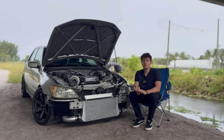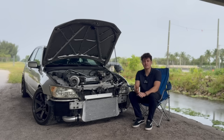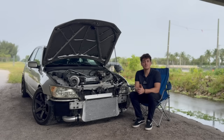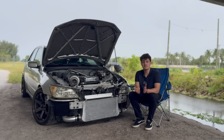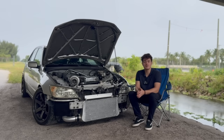In terms of other transmission options, you can run a 6L80E, a TH400, an 8HP, or a T56. I'm currently working on the T56 stuff — there is definitely a way to convert those to an all-wheel drive configuration. For transfer cases, you're limited by what transmission you can adapt to the 2JZ. There are already 2JZ/1JZ adapter plates for the 4L80E, so you can buy that and get to the races. Same for the 8HP and the T56. The T56 parts are still in R&D — they have to be run through their paces to make sure they'll handle the stress and power. I expect that done before the end of the year.